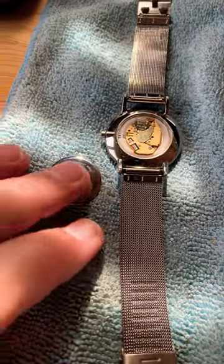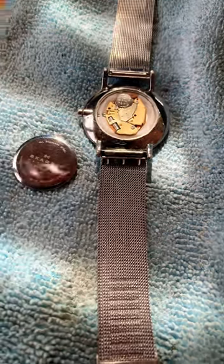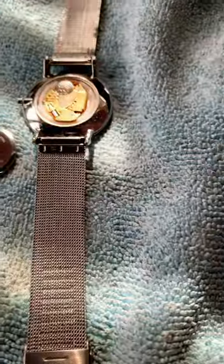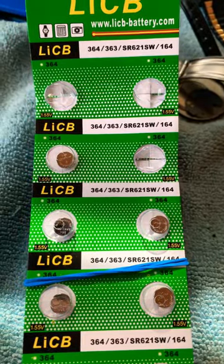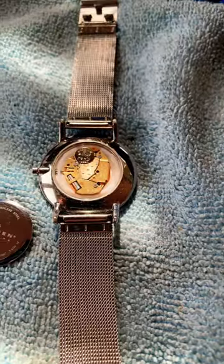Now these are snapbacks and they are kind of difficult to get back on. Getting them off with the tool is not hard. I usually use this tool to get the Skagen watches off with — it pries a little bit better than the knife-looking tool. It looks like this one has a 621 battery, and that is a 364 equivalent. Link below for those, you know that drill, but we are going to swap that out and see if we get some tick.